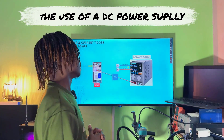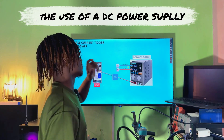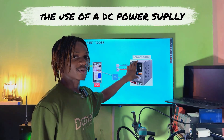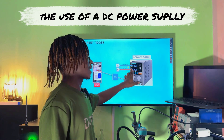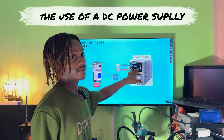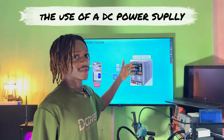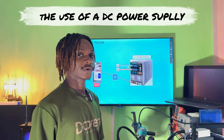When troubleshooting a dead mobile phone using our DC power supply, you connect the phone, then press the power key. When you press the power key, you are not just trying to switch on the phone — you are trying to switch it on and observe the current consumption trigger of the phone through the DC power supply display right there. If you press and see no current trigger, that indicates a fault.